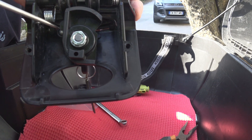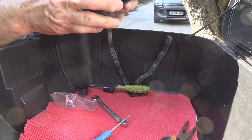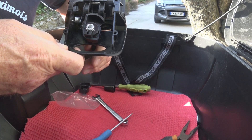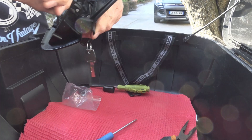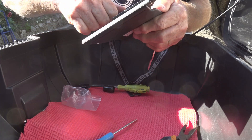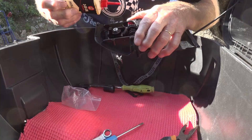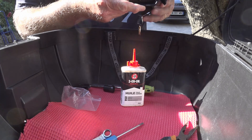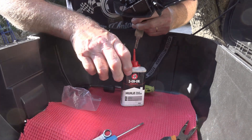When you put it back together now we can see it functions - nice and smooth. I'm going to do it up tight now and put a little bit of oil on there - a bit of 3-in-1 oil, a bit of WD-40, or whatever you wish. A little spot on the ball bearing. So smooth. This is all done. The next step is to put it back together in reverse order.